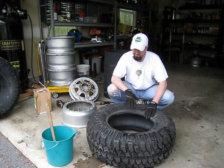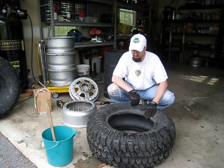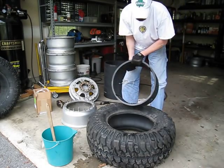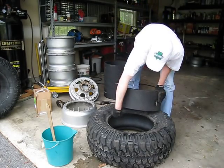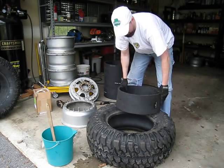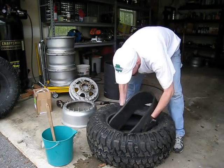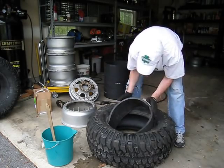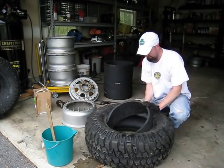To begin, the most essential part of this split rim design with the beadlock is we've got to start by getting the beadlock inserted into the tire. As we saw previously, this is the beadlock portion — it goes inside and is going to fit inside each of the lips of your tire. It's a little tricky to get it in, but essentially it's kind of the reverse of the process. You're going to squeeze it together in order to get it down on one side, then slowly work it down until you can get this lip pushed down inside the tire.